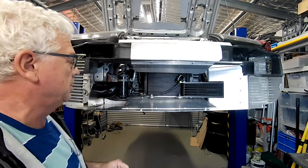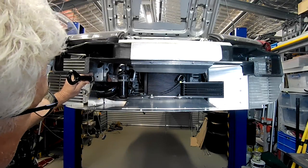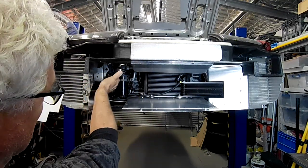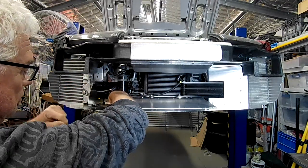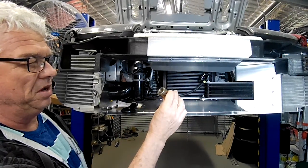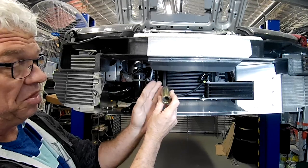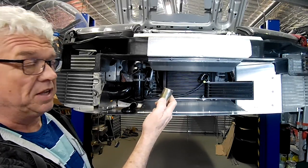I think I've just about got it nutted out. The tow hook really needs to be somewhere about here, but it needs to be quite forward — around about kind of there. I plan on putting some 6mm steel plate there and bolting it through these bolt holes and up underneath, maybe even slipping a few more in — so it'll be a bit of a bolt-on affair. To get this out further, I've found some spacers in amongst all my stuff — heavy wall zinc plated spacers. They're really perfect. The length is pretty spot on. I'd ideally like them to be a little bit longer, but I can probably make do or cut a piece off one and extend it onto another.